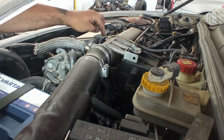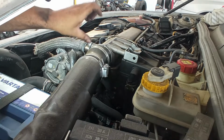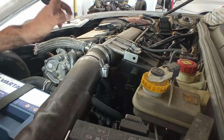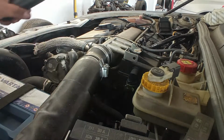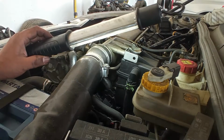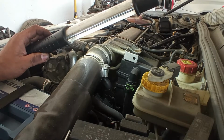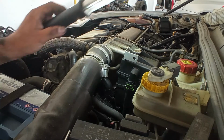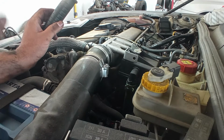I asked the machinist to make a tool to see the compression here, because I have the gauge but I do not have a tool for that. While he's doing that, I'm trying to see other stuff. I try to see if I have fuel leaks, because I'm smelling fuel. It can also be from the exhaust. Okay. But on the diagnosis, I had fuel pressure readings. Well, it does not matter. We have to test everything.